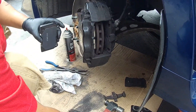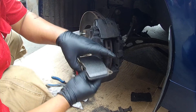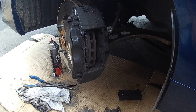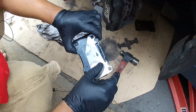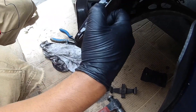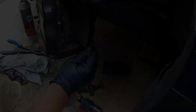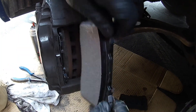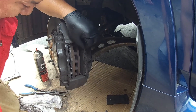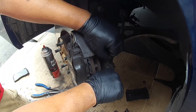We got our backing plate clean. Just keep them separated as far as which goes where. Slide the pad into place. Got our next brake pad — put the backing plate into place. Don't touch the surface, and don't install these backwards. I have seen where guys will actually put the brake pad material facing outward and not towards the rotor — it doesn't like that at all. I didn't push the piston in far enough, so just put an old pad back in and push to get the pistons to go back in farther.